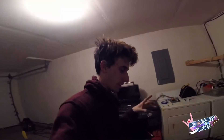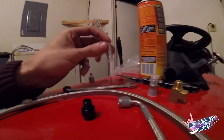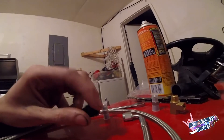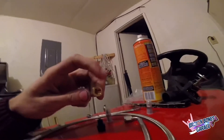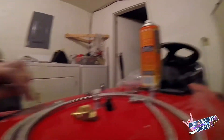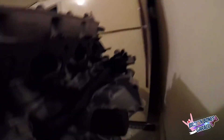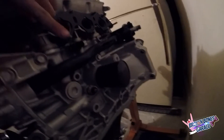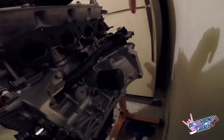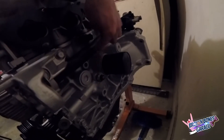I just watched the video to see what fittings go where. These two are not restrictors — they're AN oil line fittings, one on each side. The threads are not the same: one is BSPT and one is NPT. The block is BSPT, so this fitting is going to thread into the back of the block where the factory sending unit was. Then the T — this end of the T will thread into that adapter, leaving the back port for your factory oil pressure sending unit and the front for this fitting and the straight of the oil line.